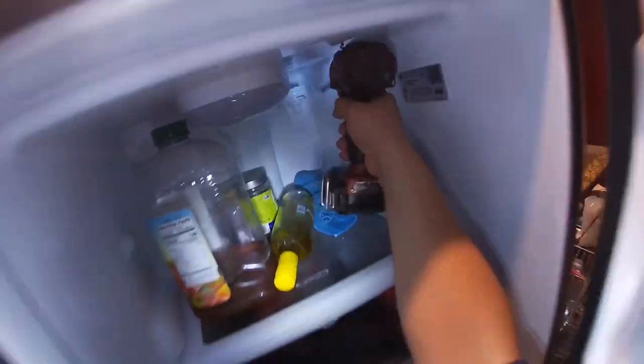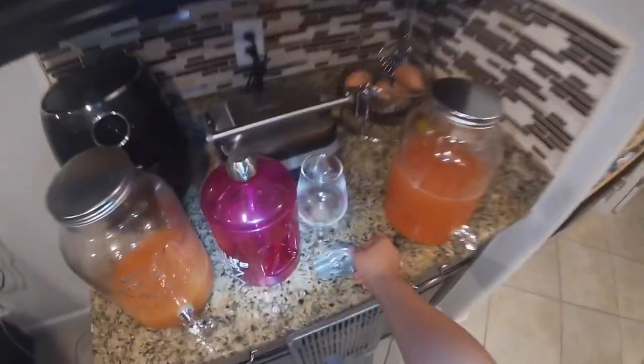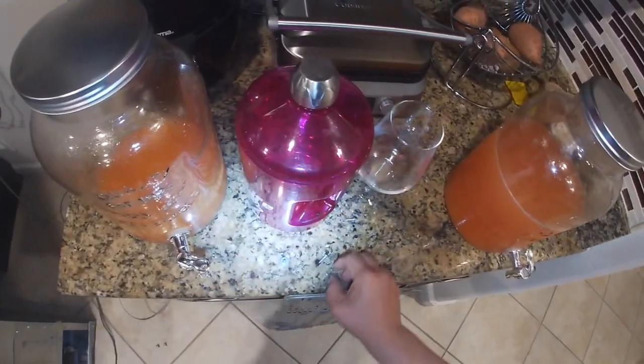After you do that, just make sure the screws are snug correctly. Now go ahead and put the piece of styrofoam you removed from the other housing, and go ahead and put the putty where it should be to avoid hot air going into this part of the refrigerator where the water hoses are. The putty is just to make sure it insulates around the water hoses.